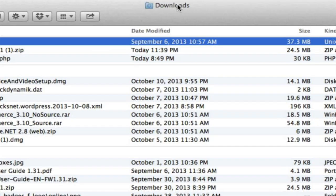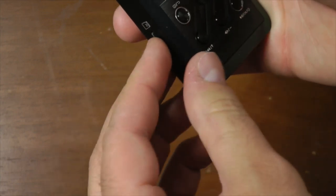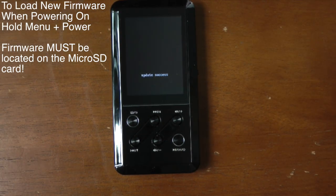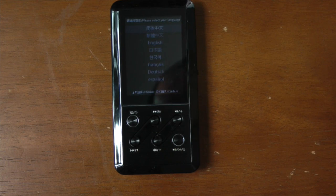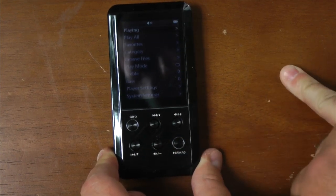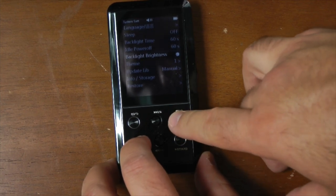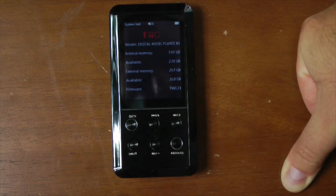That's one of my qualms — if you don't have a micro SD card, you're not going to be upgrading the firmware. So you put the SD card in, and then to actually do the firmware update you hold the top-left and bottom-right buttons together, and it'll start up and roll through the process — it takes a little over a minute. It'll boot back up and the first thing it's going to do is ask you to choose your language. To check your firmware version, go all the way down to System Settings, then down to Storage and Info. You can see that you've got 1.31 on there now.